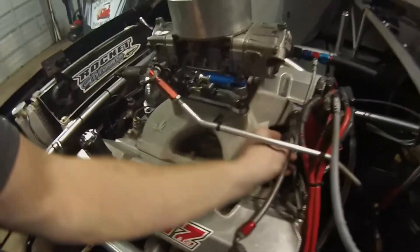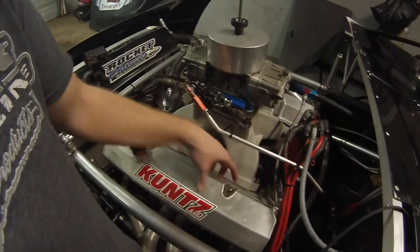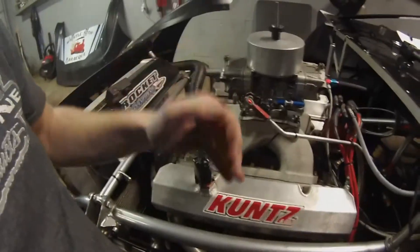Once you've done that, you can remove your oilers. I had an oiler that went right here — make sure all that's good and clean. Take your valve cover bolts off, taking them off nice and gradual. Once you get them all loose, just zip them off, then you're ready to start. Once you've got your motor cleaned and prepped, you're ready to start running your valves.